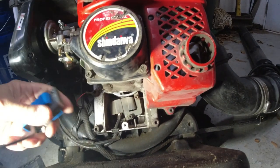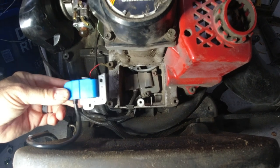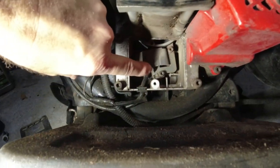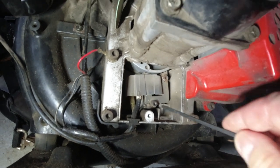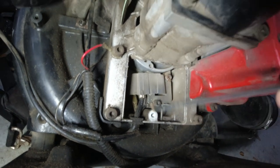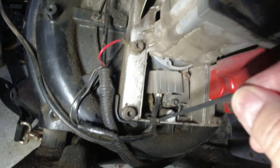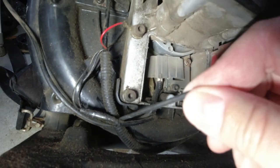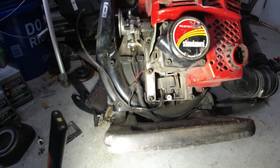Here's the new coil — it looks the same. Then there are two more Allen bolts: one here and one here. You take those off and there's a connector right in here that I've got to disconnect somehow. Once I get to it, I pull this out. I need to reuse this little bushing right here — that's really hard to get — and then just replace it. Fairly simple.